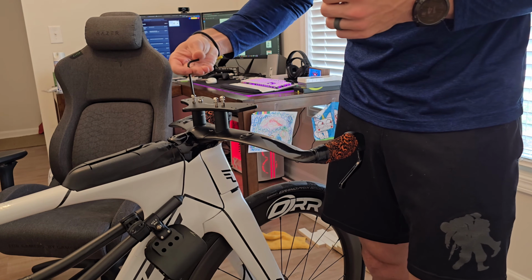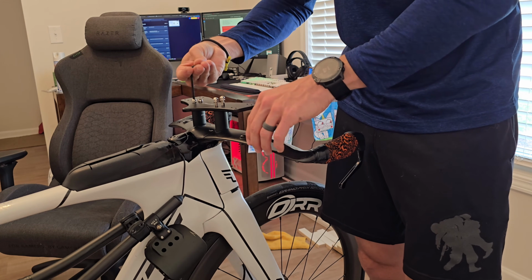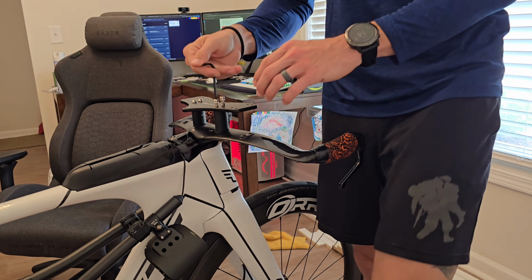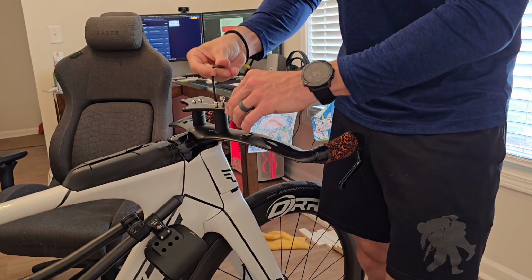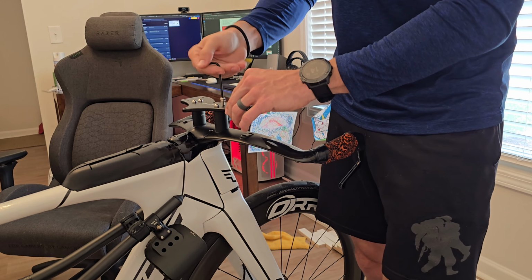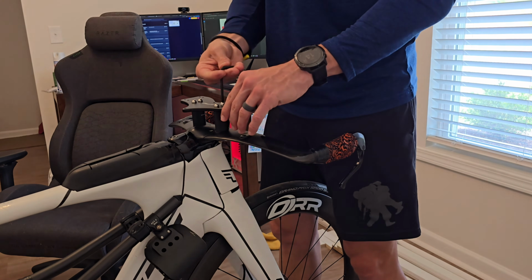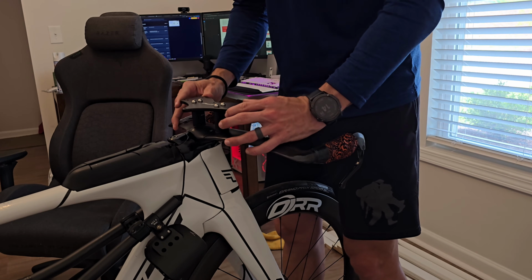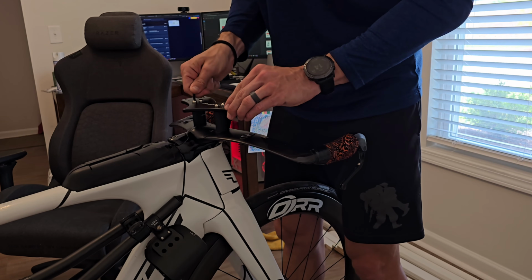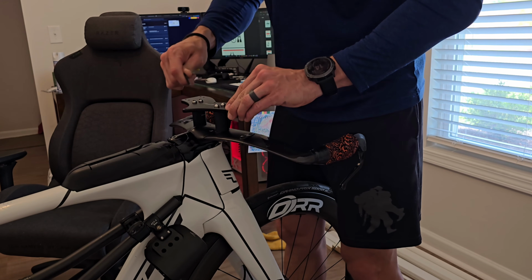And what you're gonna want to do is use the Loctite 242, I believe is the number, the blue one, or you can use any Permatex or whatever brand it is, but it's 242. It's going to be basically your medium Loctite. So that's something I wanted to add here. And then make sure that you're tightening these down to roughly 8 Newton meters. That's the recommendation that was put for the IA3. And yeah, so definitely use Loctite on these because the vibration and the movement is going to loosen your bolts, because mine loosened during my ride. So back to the video.